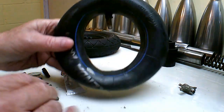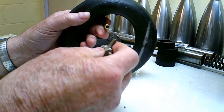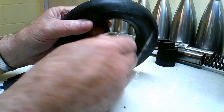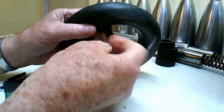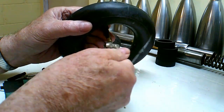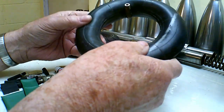Before I put this back in the tire I'll test it. The other thing I had to do was clean up the end of the valve stem because it was getting kind of banged up. I can't use a dust cap on here because it comes too close to the fork on the tailwheel. I kind of ground that off a little bit. These tools have a die in there so they can re-cut those threads and make sure the valve stem turns easy. This tool here is useful for cleaning out where the valve stem goes in — the Schrader valve gut. There really just isn't much clearance when this thing is spinning around so I can't have a dust cover on it, which I don't like.